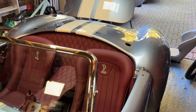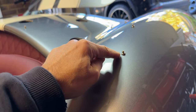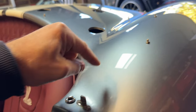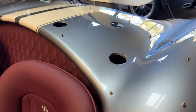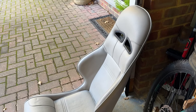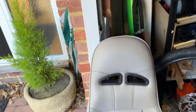It looks amazing, but there's a lot of work to put all the shiny stuff back on. We've got to be careful for IVA because that's in just a couple of weeks. With the soft top you get these studs fitted, but those will fail IVA because of the sharpness and the radius, so we need to put little rubber end caps on the stud threaded bar. We've also got seats with a built-in headrest so the harness comes back down over your shoulders correctly.